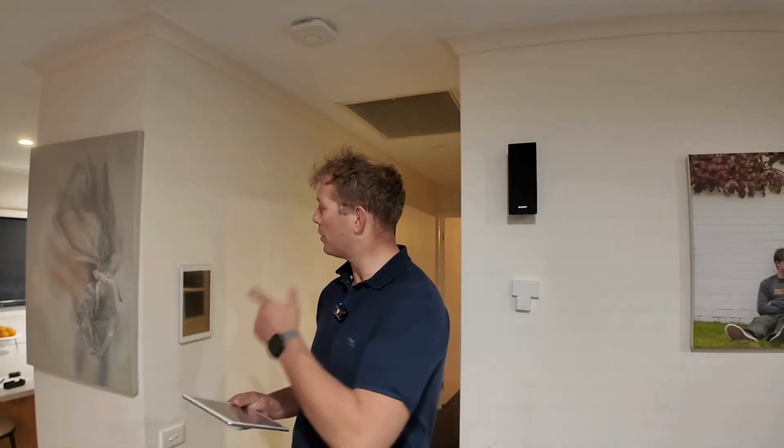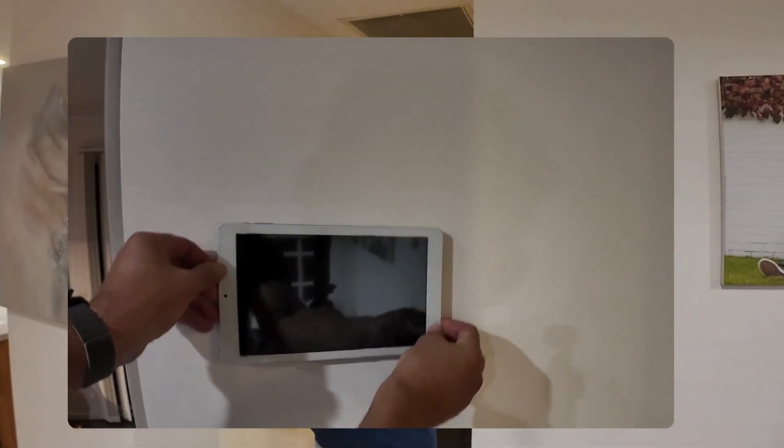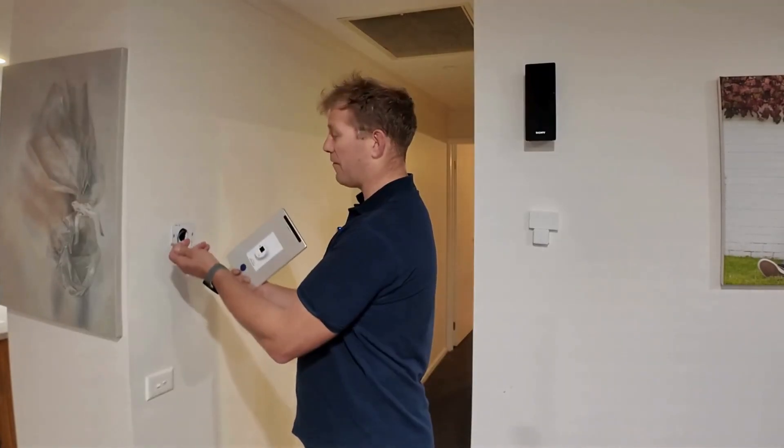The first thing you want to do when taking the tablet off the wall is we just don't pull it straight off. If we go up close on our touch panel, they've got little clips or mounts on the back. This is called a puck and this is where your cable connects — the RJ45 cable. So we're going to disconnect the cable, take the touch panel, turn it to a 45 degree angle, take it off the wall, and then remove the Cat5 cable.